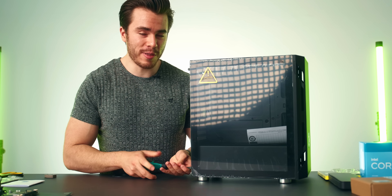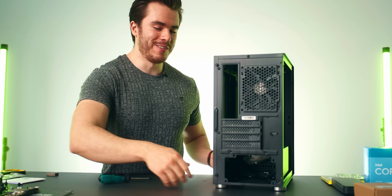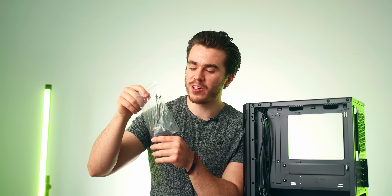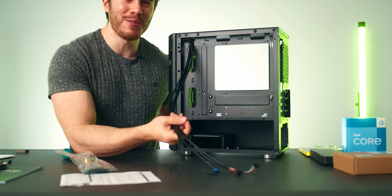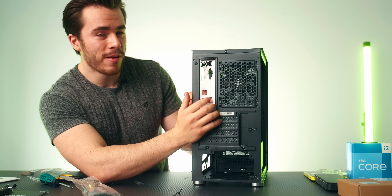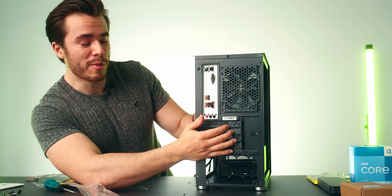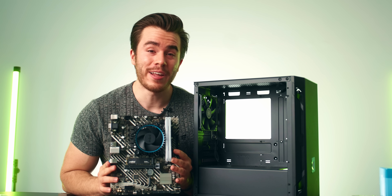Before putting the motherboard into the PC case, first remove the side panel, then open the back side panel. In the baggie inside are all the screws you'll need to install the motherboard and anything else. Now install the IO shield — there's a flat side and a side with pokey bits; the pokey bits face inward inside the case. Line it up with the four corners on the back of the case and press each corner in until it makes contact.